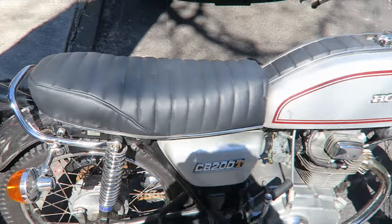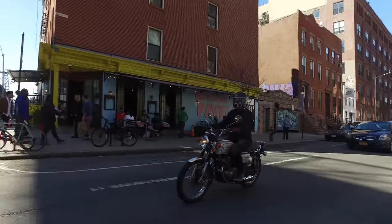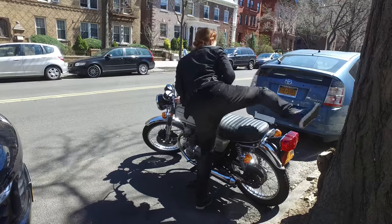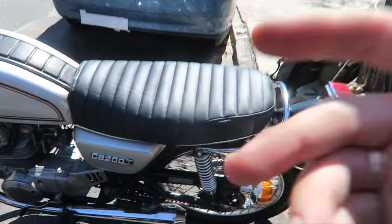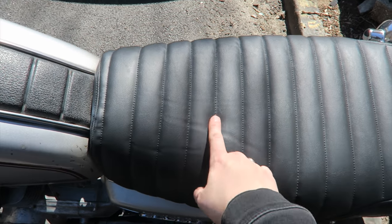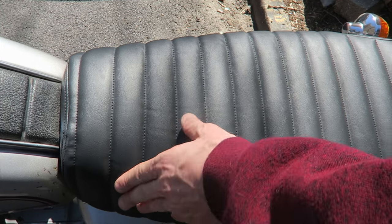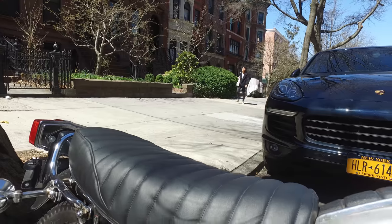Overall, I'm pretty pleased with my new motorcycle seat and I had a lot of fun working on it. After riding with it for a bit, both as a driver and a passenger, I can say it's just as comfortable as the original and helps get my short legs a little closer to the ground. It is forming creases where the material scrunches when I sit on it, so next time I might slope the foam a little differently, change the pattern to have a seam along the compound curve, or maybe just use a thicker material.